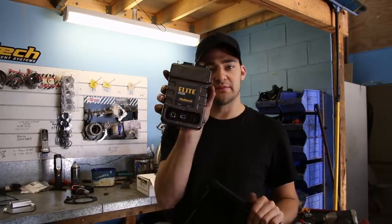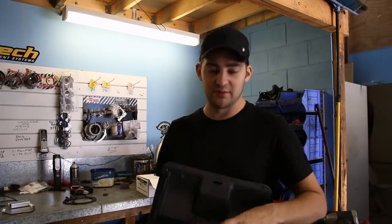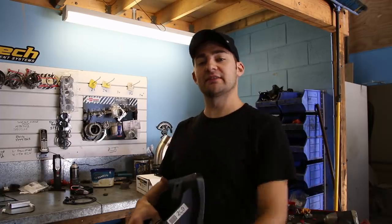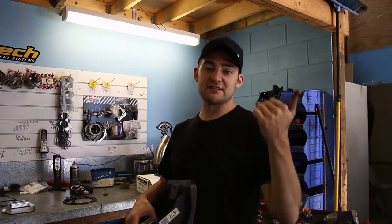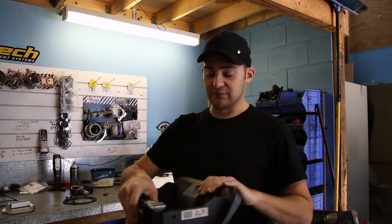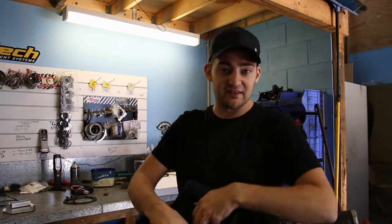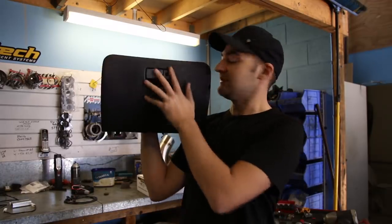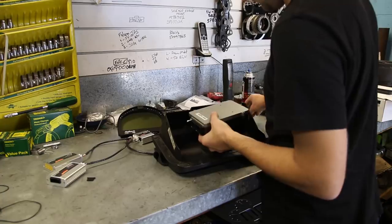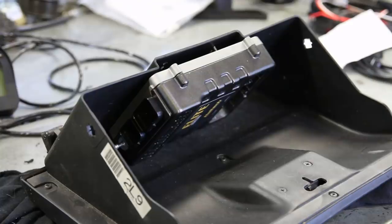A tricky part is trying to find a spot to mount the ECU - we want it to be accessible but also neat and not somewhere it's going to get kicked. We don't have a whole lot of room under the passenger footwell, so we're going to use that space for our amplifiers and CAN bus hub. The ECU we are going to put into the glove box. It's not something I've personally done before, but for this particular experiment it'll work quite well. We'll be able to get to the CAN ports and USB ports really easily. The ECU has threaded holes in the back and we can use those to attach it to the glove box.